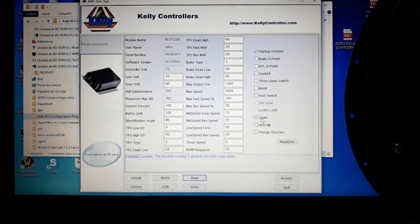The cruise function works simply: when driving above a certain speed (usually around 400 RPM), if you hold the throttle at a steady position for more than three seconds, it will engage cruise speed. As soon as you activate the brakes or move the throttle again, cruise is disengaged. The anti-slip function aids starting on a climb — it retains the vehicle if it starts to move from a zero velocity position, helping with hill starts.